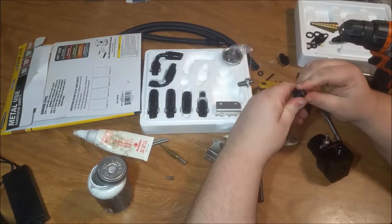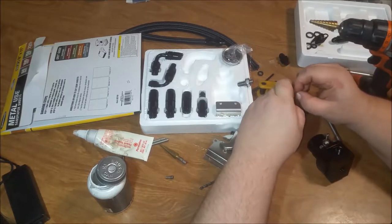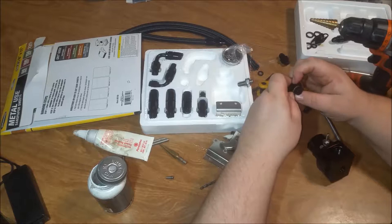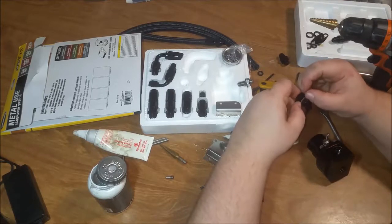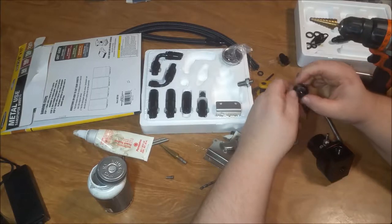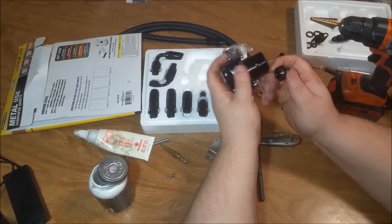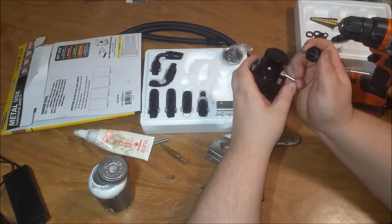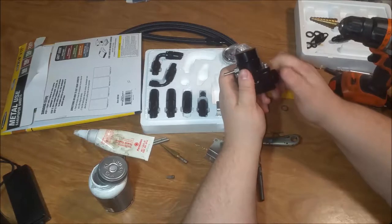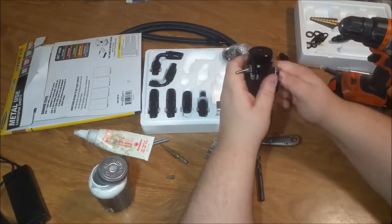Viton ones are just going to handle a lot more pressure. And I think they're chemical rated, but I don't know what chemicals. You'd have to look that up. I've heard of other people using Viton O-rings in this situation. And I know the other ones aren't going to be good enough, in my opinion, anyway. So that's the side I want to use it on. You can block off this side or this side, and it'll work.